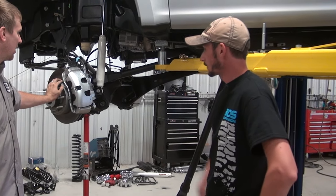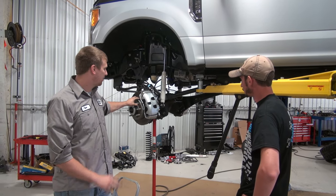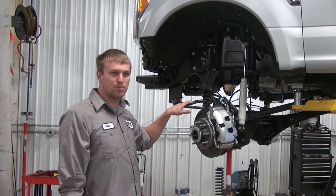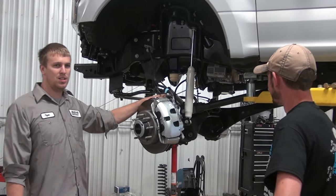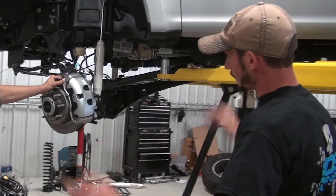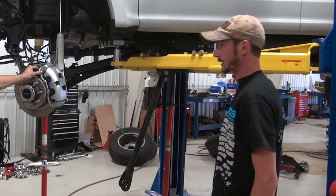So what are we putting on here for a lift kit? This will get a new prototype four-link suspension. The benefit of the four-link is improved caster change through wheel travel. You'll actually get a six-inch coilover suspension in the end, similar to previous gen — we'll get a replacement lower mount and upper mount as well. Now this is the 2017 so it's obviously the whole new platform, so we had to hunker down and start designing brand new stuff for this.